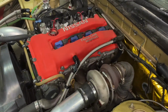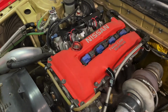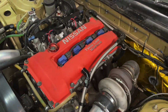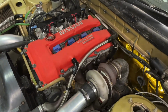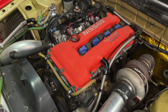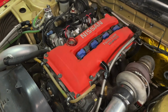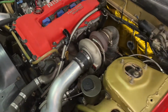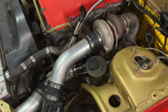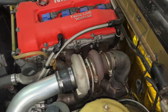Next video will probably be digging into the fuel issue. I've got an idea of where to start looking. I can't see any leaks externally, and the reg hasn't backed off. That's nice and tight still. So I might pull the cradle out of the fuel tank and have a look at the rubber hoses in there, see if it's leaking internally. But as for the turbo stuff, that all seems to be good. I'll get it up to temp tomorrow, and just check the flanges, make sure nothing's leaking. But yeah, seems good so far.